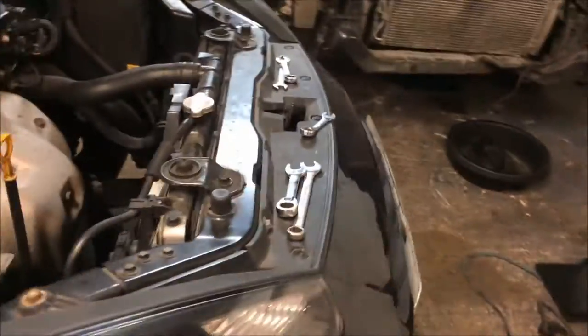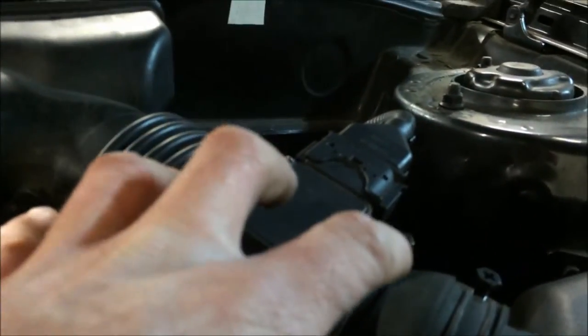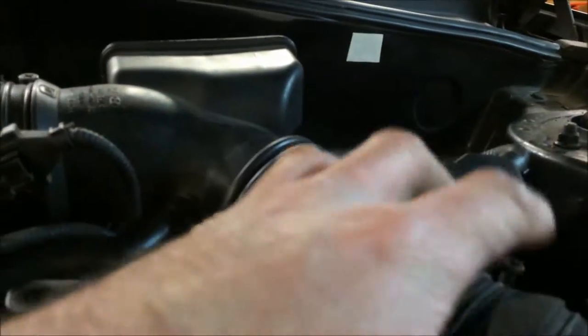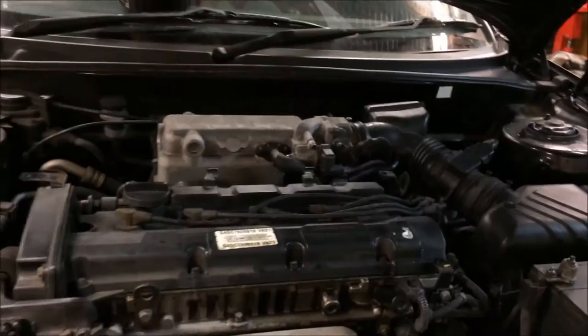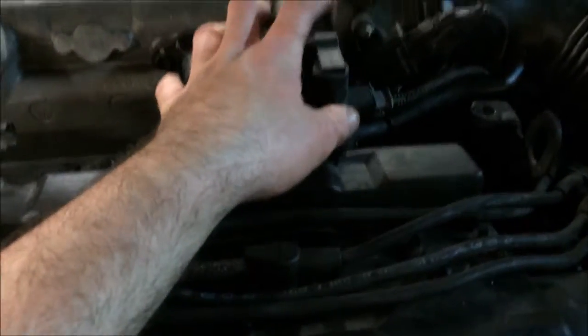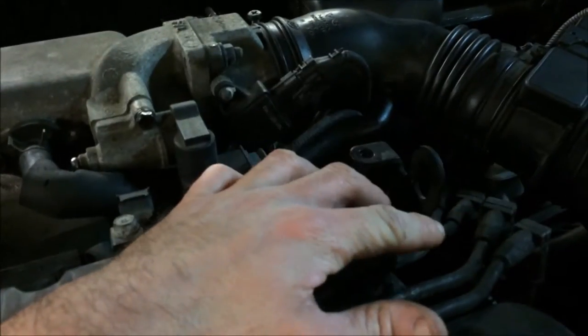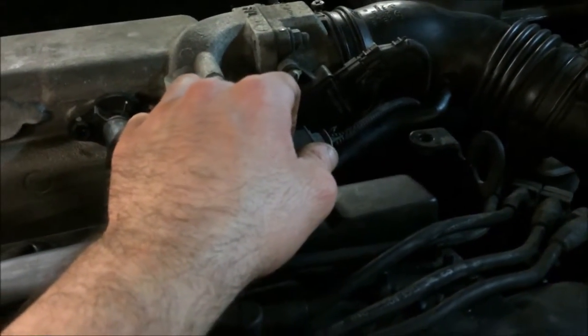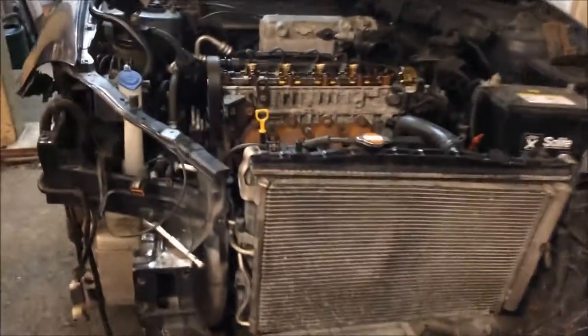I think it was last weekend I did it. There's a cable tie round here — put clips on, made sure they were tight. So it's either going to be the idle control valve — which is that one — that's causing it. Or throttle control valve, or mass airflow sensor probably. Because it just comes up as crank and cam correlation, so I've swapped the crank and cam sensors off that one. That is the automatic one that I've put the engine in. I've ordered the timing belt kit for that one.